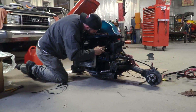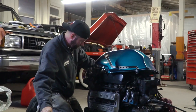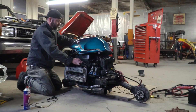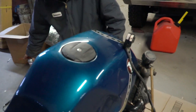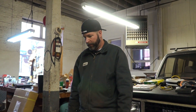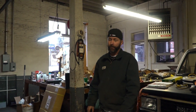This thing was sitting 15 years! We still got to put some fuel in it. We didn't have quite enough gas to hear it run constantly — maybe the fuel pump could be bad. That fuel was in that tank for 15 years, and to be honest, I didn't hear the fuel pump come on.